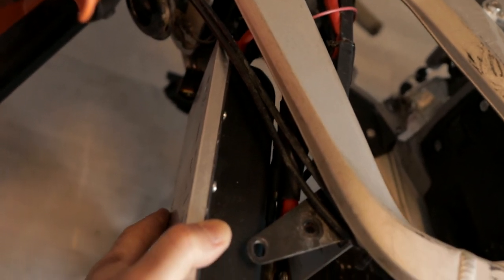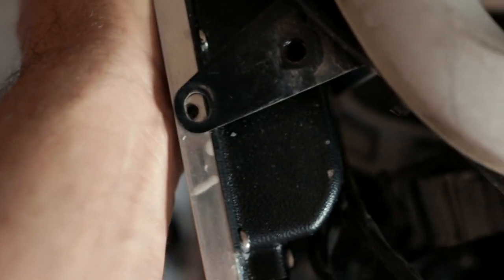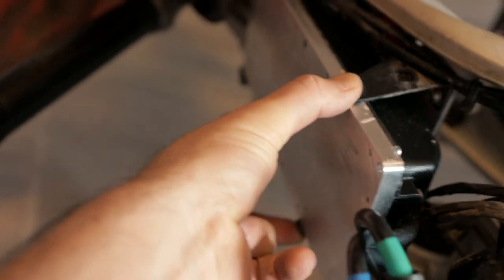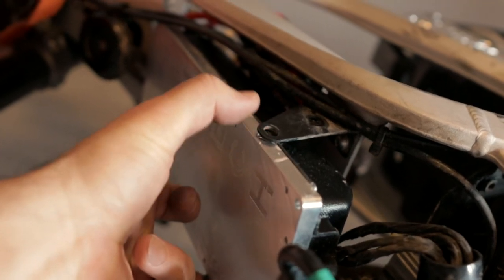This socket is for the regen brake and we will use it. Then move your Syntech inside your frame. We need to have the wiring inside the frame — position the controller so that the wires go inside the frame. The Syntech is more narrow than stock, so you should bend these brackets a little bit inward toward the center.